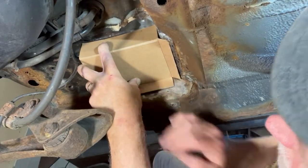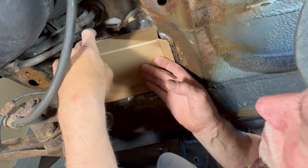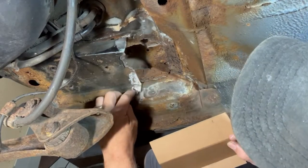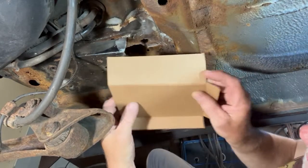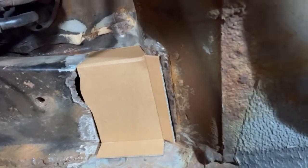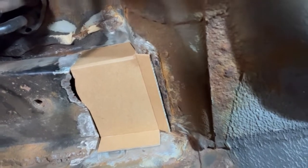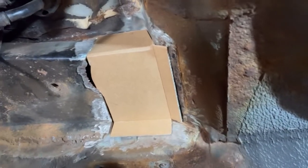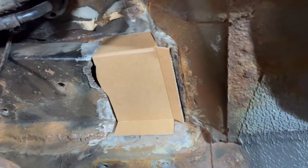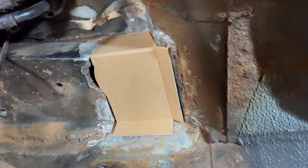Just fit the cardboard up in here — everything looks really good. I'm going to cut this angle back along here so it fits up nice, and where the old flange ends I'll take a couple measurements, mark the cardboard, and cut this off. Got the cardboard finished up and cut in place — that was a piece of cake. I'll transfer this over on a piece of sheet metal and bend it up the same way. We're also going to need to put the t-bar back in place. There's a tapping plate and hole for the t-bar that has to go in here, so I'll set the t-bar back in place and put a transfer pin through to get the hole located.